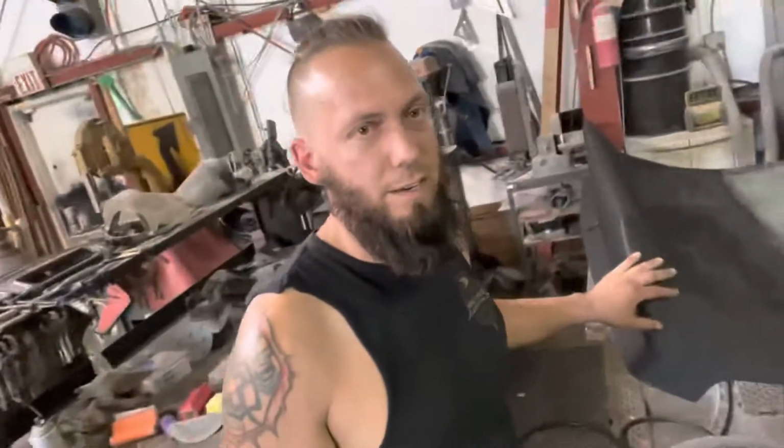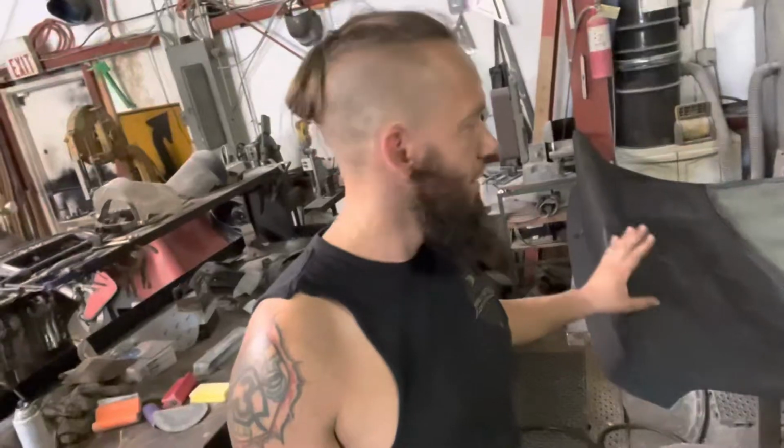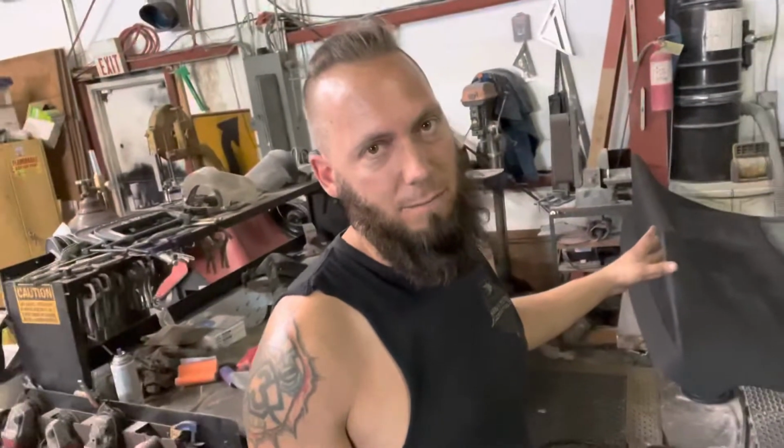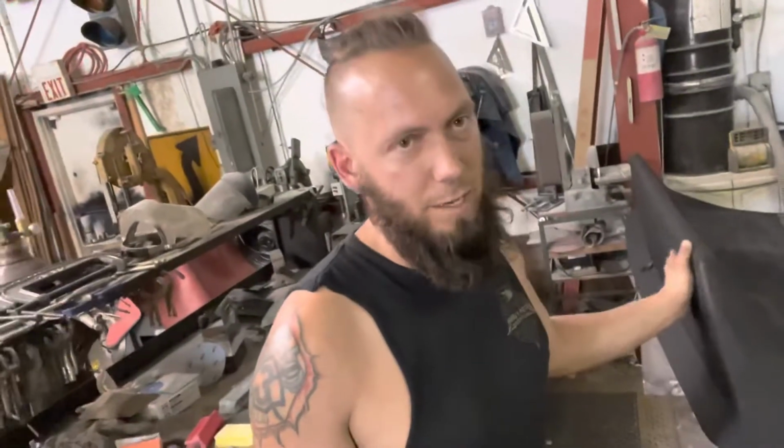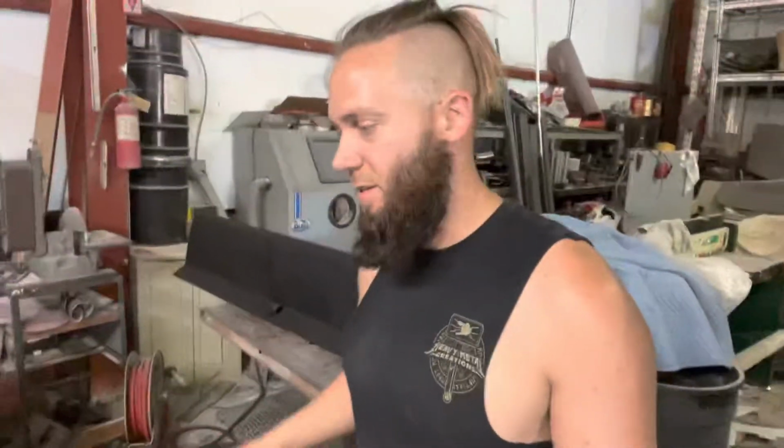Especially when you sand it, you can then see your highs and lows a lot better because you have black where the sandpaper's not hitting it, and you'll be rubbing through where it's high and getting back down to the Bondo. So it really helps you get those highs and lows a little more in perspective. Also, the gloss black will start gumming up your sandpaper.